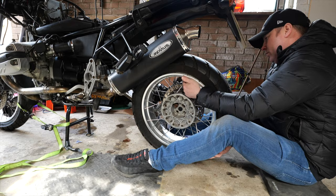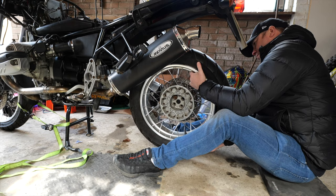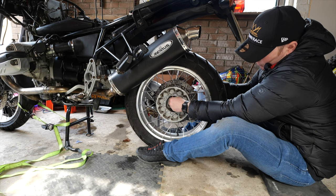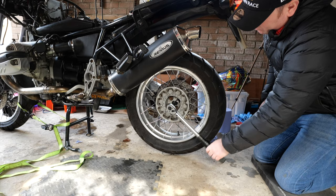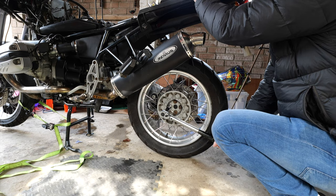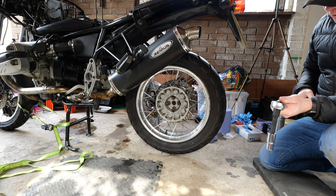The wheel was a little bit fiddly to fit but once I put one nut in and used my feet to prop the wheel up I got a bite with one nut and then managed to fit the other three without issue. Then I used the torque wrench a bit more and then a final torque of 105 newton metres.